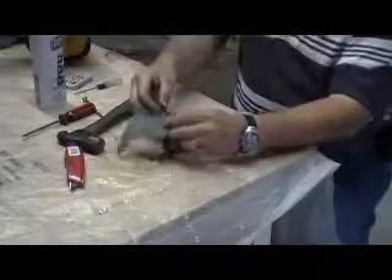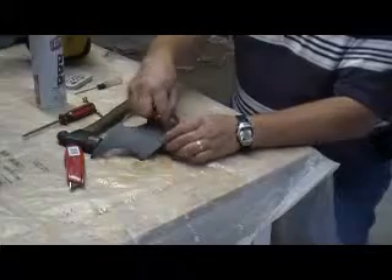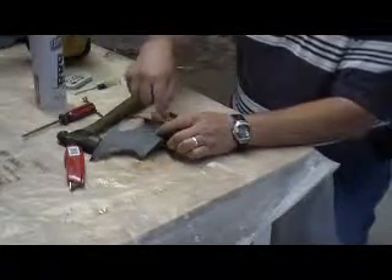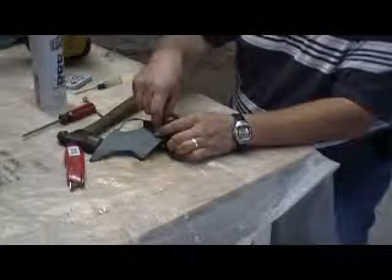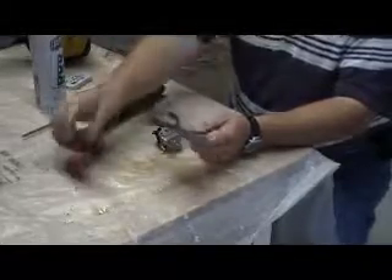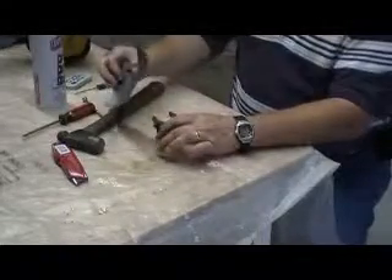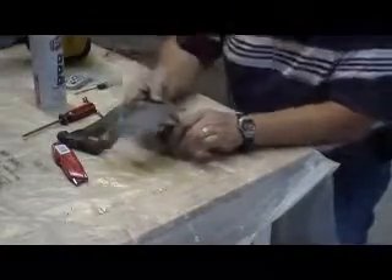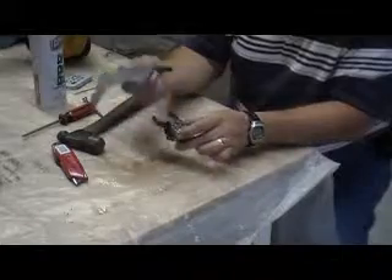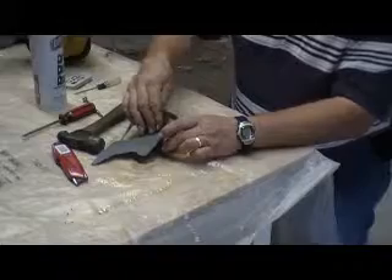The only thing I have to do is take a little razor or something and cut it out. It's kind of like going back to school — you cut out the area for the gasket, cut out the outside, cut out your outside ring, cut out your inside holes and your bolt holes. You're going to need a sharp razor to do it, so be careful with that. And the good thing is, if you mess up, these gaskets are so small — this is a weed eater gasket — you can always make a new one.